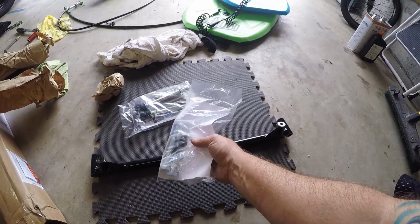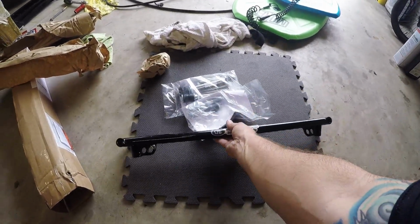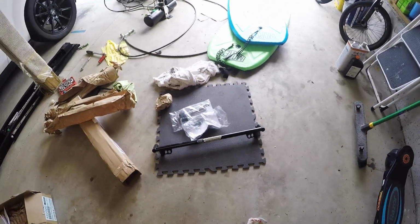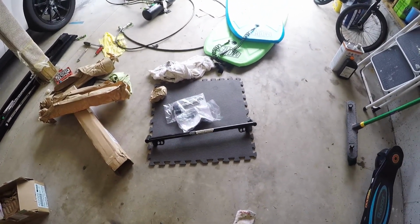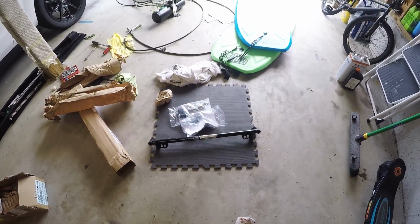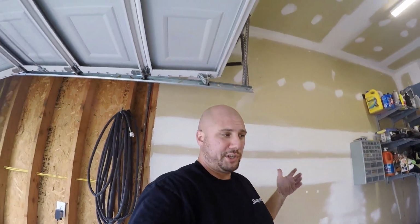And these are the bolts that probably go up to the K-member. So again, super simple setup. What this is supposed to do is essentially tie in the transmission to the K-member, which ties into the chassis and should basically, again, common sense, keep things from twisting up. So we're going to go ahead and get the Shelby up in the air on the quick jack. So we're going to get underneath it and we're going to show you guys the process.